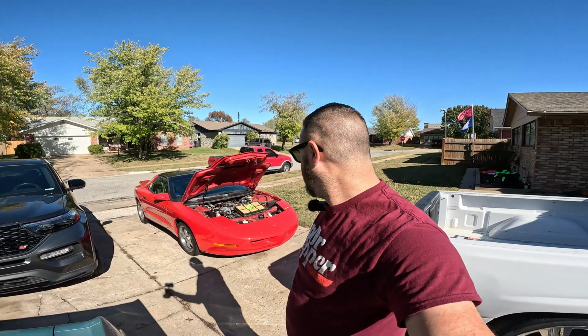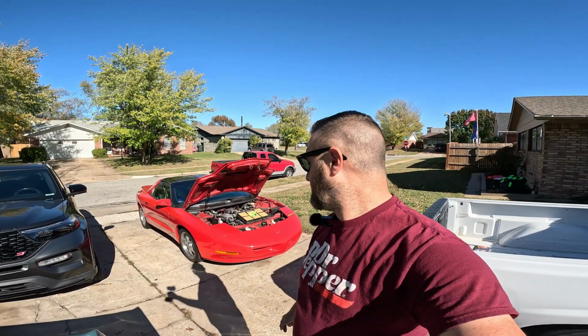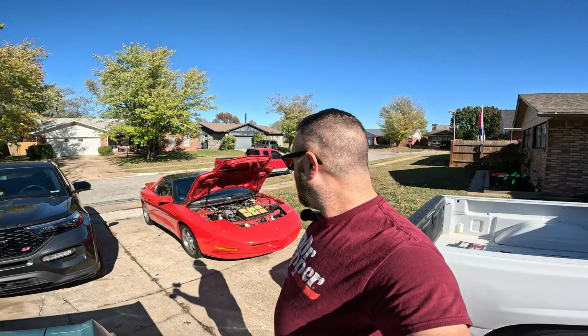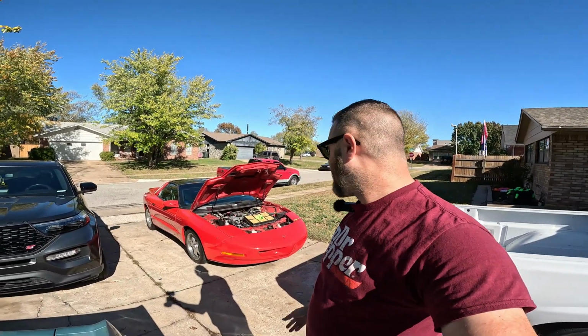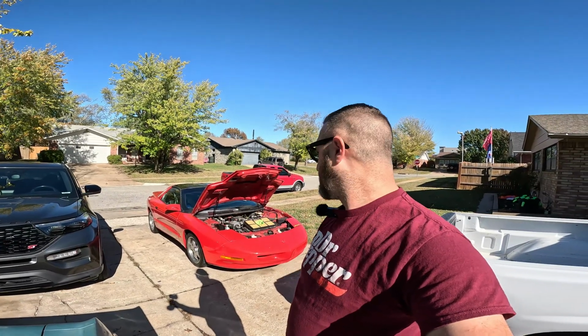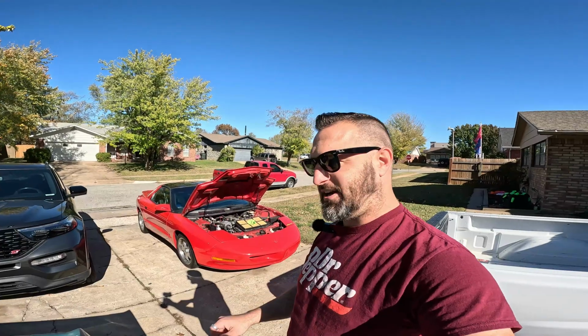Got an LT1 in today. Pretty nice car. It's a '94 Firehawk, car number 436, automatic. It's got a stock converter, stock gear, so 3.23. It's got a built motor. It's like a 355 with Lloyd Elliott heads and a 227 Crane cam.